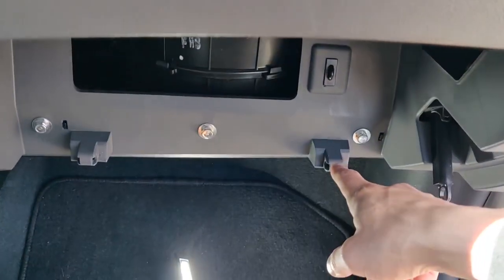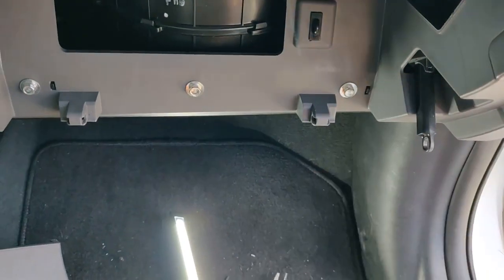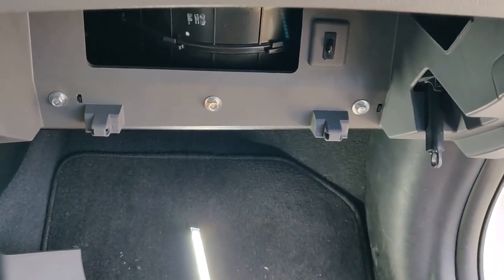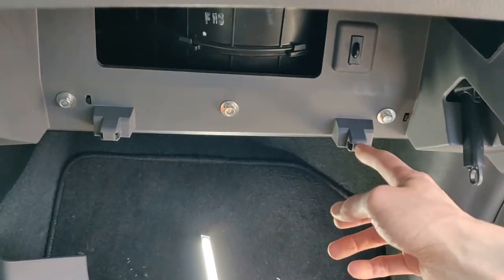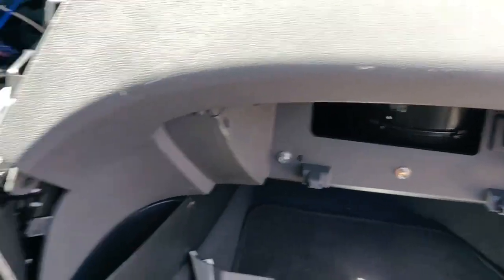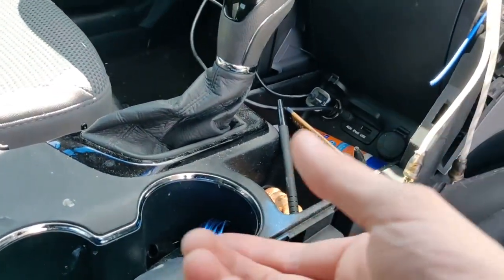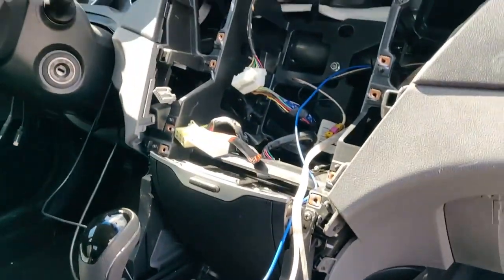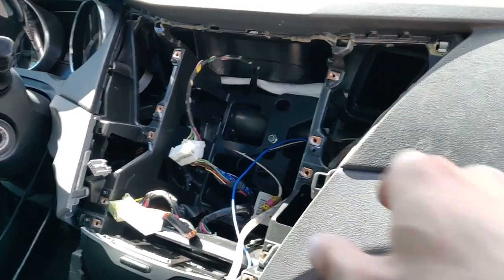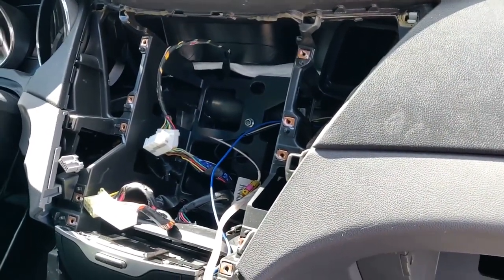Getting these pins out of here is kind of a pain in the butt, because of the stress of the dashboard open glove box on the pins. You've got to pinch the pins and then slide them out towards the center on each one — that took the longest out of anything. These side panels, you get from back here, pop them straight up and pull them outward towards the rear of the car. There's one screw on each corner, then two screws on each side of the radio, and that pops out with about six leads in total.